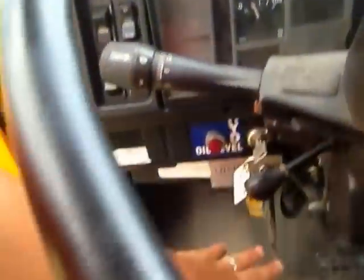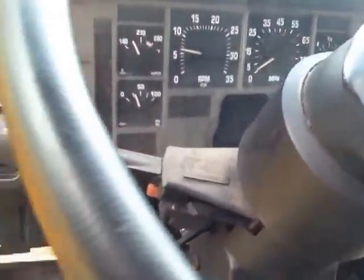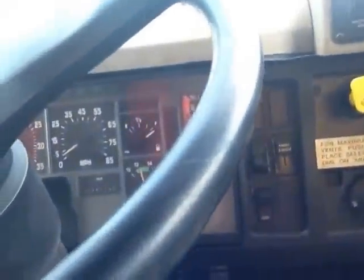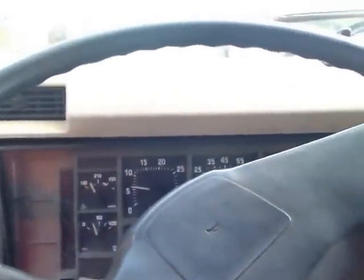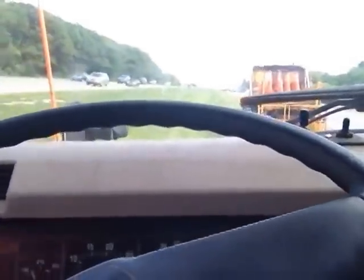So just a quick review: the engine brake helps stop the truck. It does not work in conjunction with the brake pedal itself — it's a separate system. It takes the power cycle of the engine and puts it out the exhaust, that's why you hear all that noise. It helps take the momentum of the engine and stops that momentum from pulling you as you're trying to stop. In our next video, we're going to put it into practice — downshifting with the engine brake using double clutch, downshifting without the clutch with the engine brake on, and a brief look at upshifting with the engine brake on.